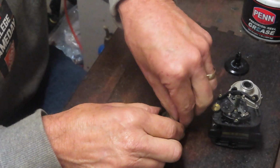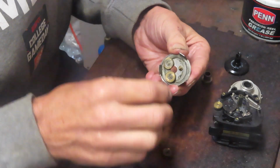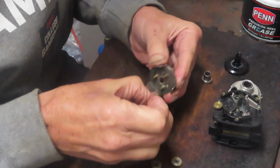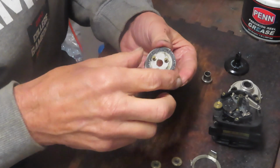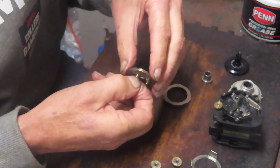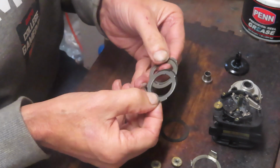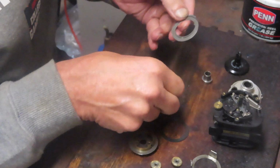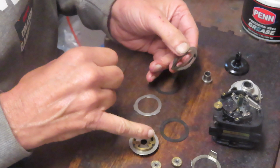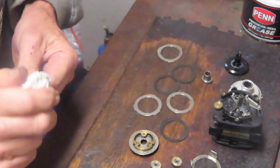Well, I guess I can take... That's 1. It's upside down. Make sure that you keep them in the right orientation. That's 2. That's 3. Lobed pressure plate, drag washer. And we have a full pressure plate here. 1 drag washer underneath. And we have 1 of those tagged washers. 2nd drag washer. We have 1 now that I would call an eared washer, except that it's inverted. It's going to go in the slot on this gear. Another drag washer, and then the final one, which is going to be the collar washer, which is going to fit into that whole assembly.